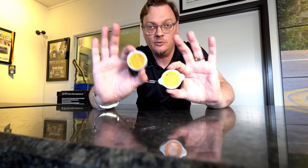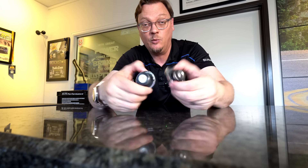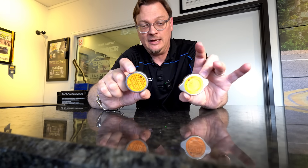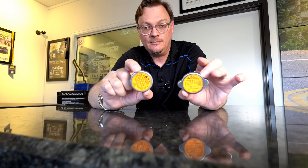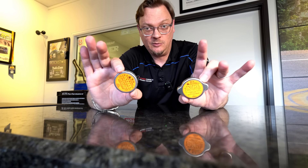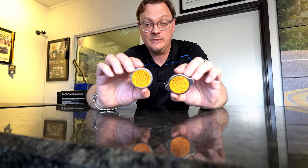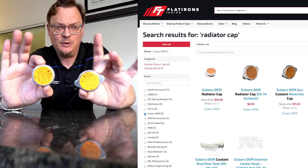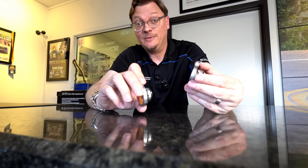There are still some '02/'03 WRX radiators out there that have no fitting for a cap, so if that will work on your car, that's a great option. Basically, that is it in a nutshell — why this is such an important detail to know, which caps are going where, and why it's just so important. I cannot tell you the number of people, especially since we made that video, that have called us up with these caps in the wrong spots, overheating and whatnot. Once you get this right, that's when you can properly evaluate the cooling system. If you've got a whole mess with your cap situation, sometimes the very best place to start is just two brand new caps, get them in the right place, prep the coolant, and see where you're at. Part numbers for these are going to be in the description — they're available at flatironstuning.com, and you can probably get both of these factory caps for the cost of one aftermarket cap. Definitely a good place to start.